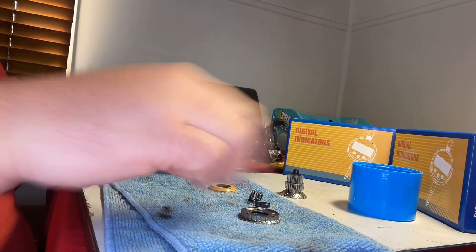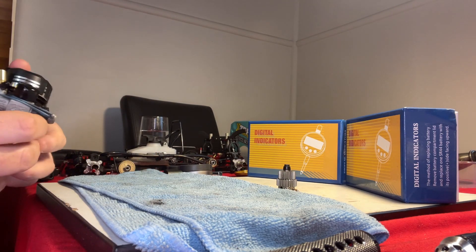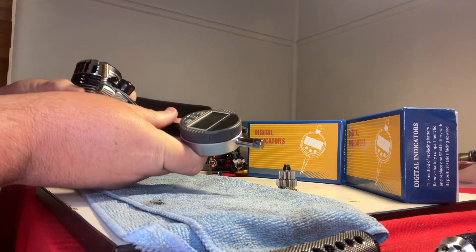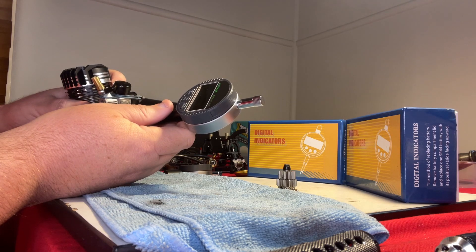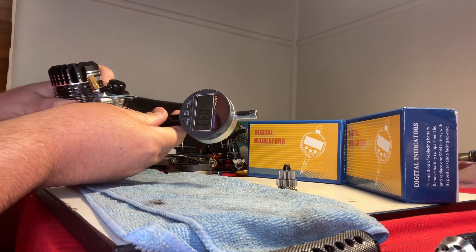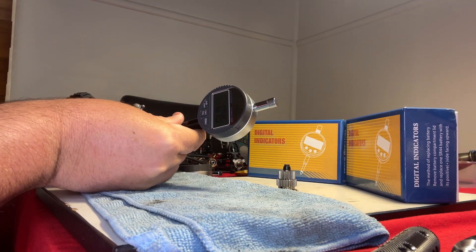As you can see from my time-lapse video, I've started to pre-assemble the clutch. I've finger-tightened the clutch spring nut retainer. Switch the digital clutch tool on — that simply goes over the crank, push it all the way down. What we're measuring is the gap from the end of the flywheel nut to your spring retainer nut, to get an exact measurement every time. We're at 0.3 — make the adjustment, go down a little more — 0.47, nearly there — 0.5, perfect.